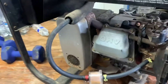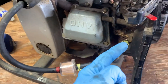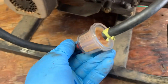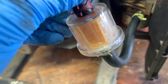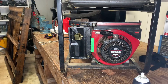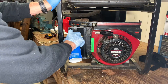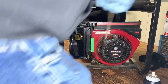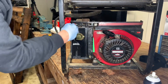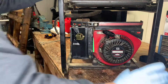Okay, I made a real stupid mistake — you can see right here it says 'flow.' I had this fuel filter on backwards. Let's put it on right and try it now.